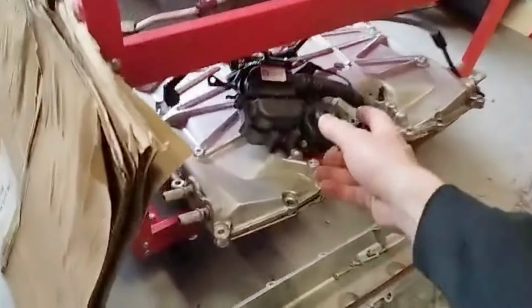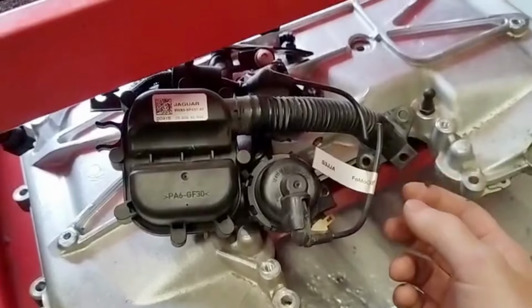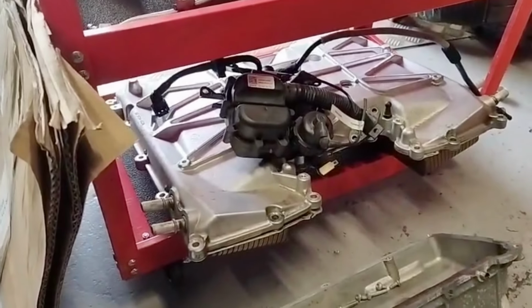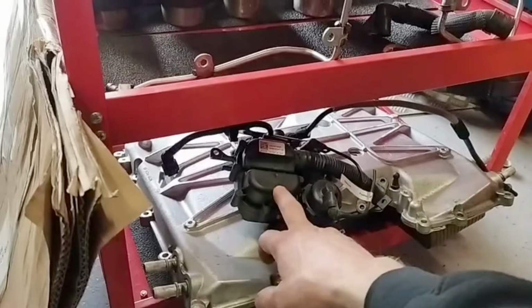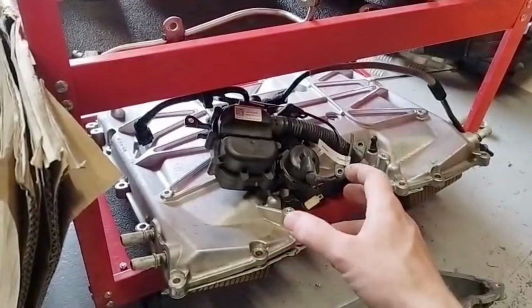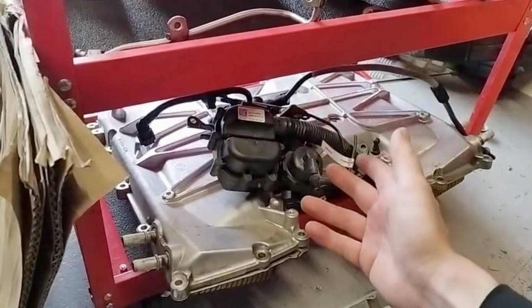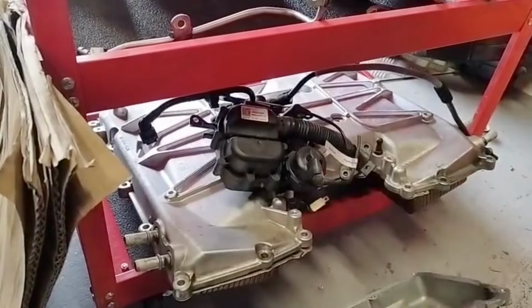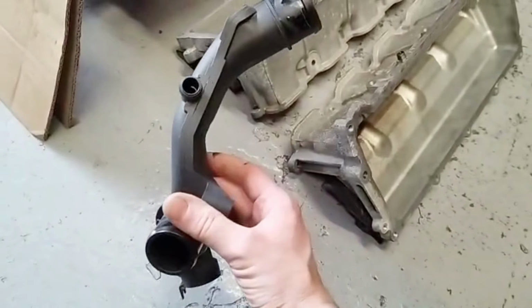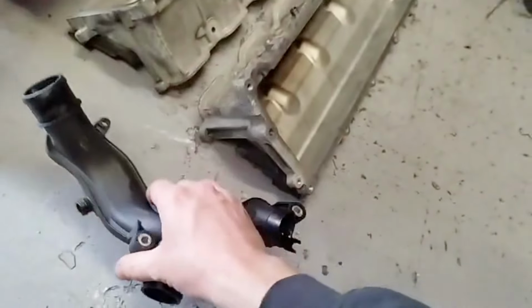And on the back of the supercharger, we've got the Symposer, which is a common thing we tend to delete. This big lump of plastic. It's already started to become old, brittle. That pipe's broke. This pipe can break and other stuff. Takes up a lot of room in the engine. That is designed to guide supercharged noise into the cabin, but in reality we don't find it actually does anything. So we tend to install our simple little delete kit. Prevents future problems, creates more room in your engine bay. Cost effective fix there. And of course, while the supercharger's off, we're going to be replacing this pipe and the connecting Y pipe for our updated metal ones.